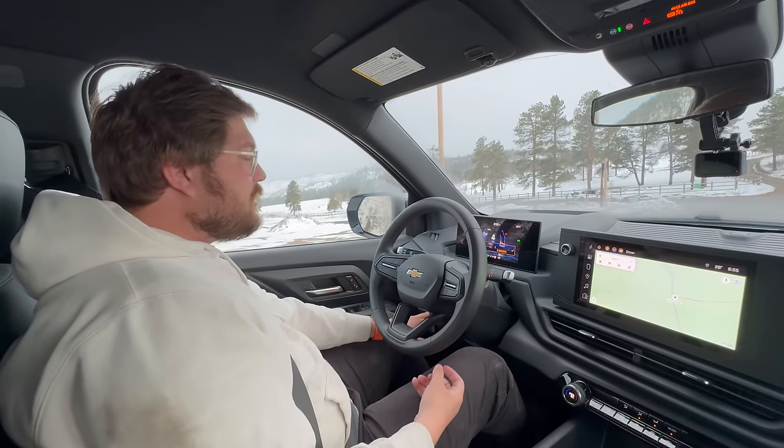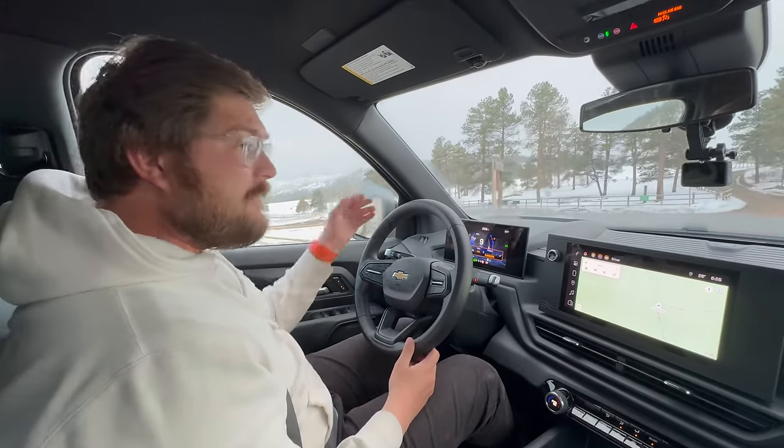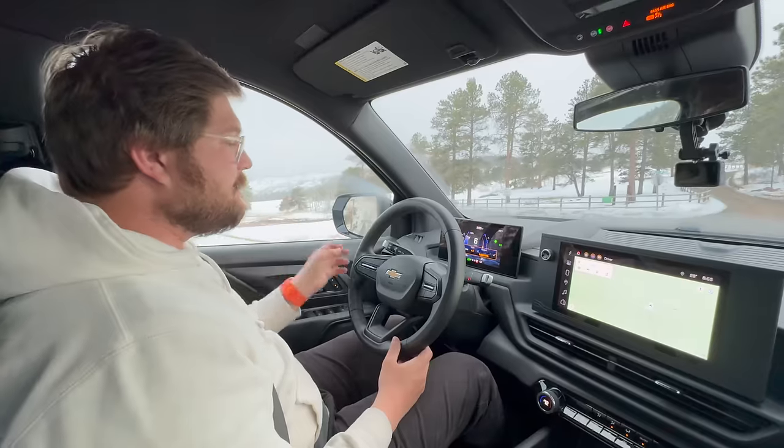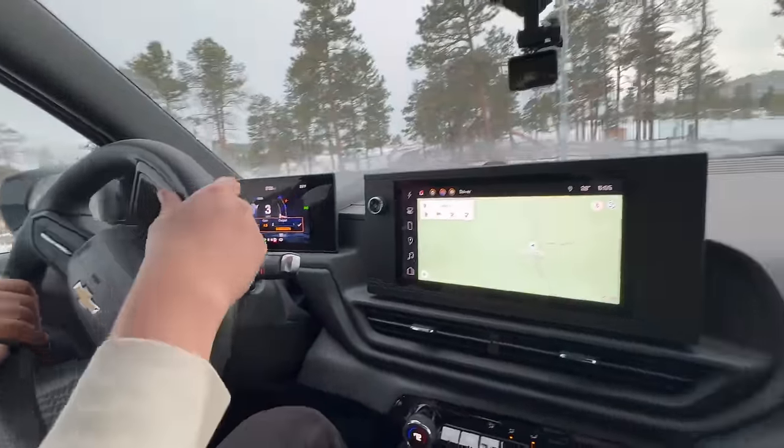Absolutely. I'm going to put the trailer brakes back. I think 5 was a bit much. I think we'll go 4.5. I was running 5.5 before. It just feels like it really does clamp down. You can see the output gaining when we use the trailer brakes, when I lift off the accelerator pedal.